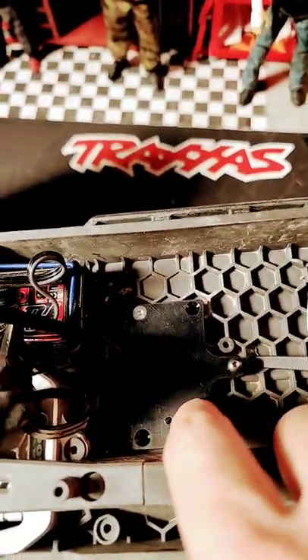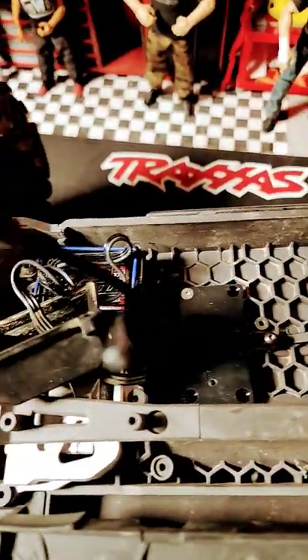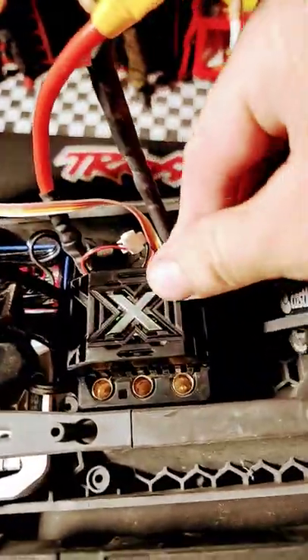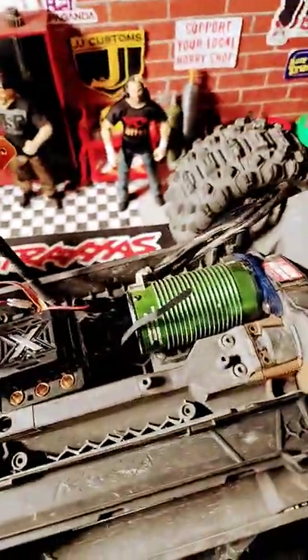What I did is use a Hobbywing plate that came out of my new ESC. I drilled a couple of holes so I can run a zip tie around it. I'm going to run it like this — I got some double-sided tape, so a zip tie and some tape should hold it on pretty good.